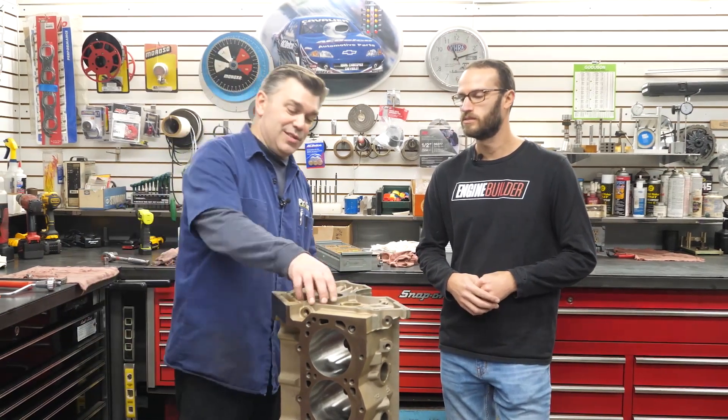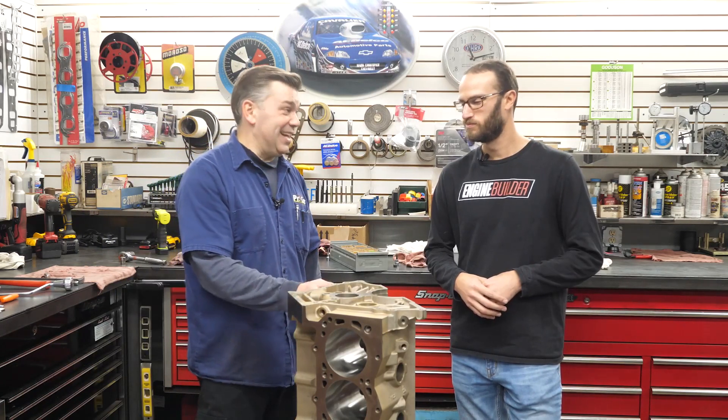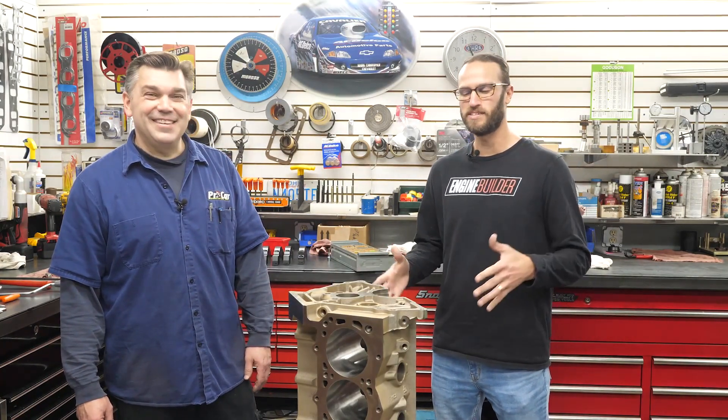We've got to tape off some stuff that we don't want the Ford Blue getting into. Chris, anything else to add before we get going on that? Yeah, there are a couple ways you can go about it — you can do cam bearings first then tape up later, but in this case we're going to tape up the block first, then do cam bearings after. We'll get it on an engine stand after we get some of the back plugs in because it's kind of hard to get to. All the surfaces we care about will get taped off — I've seen engines torn down with paint in the valley and paint where the head gasket goes. That's definitely not good. But yeah, we'll get it all prepped up and get it Ford Blue.